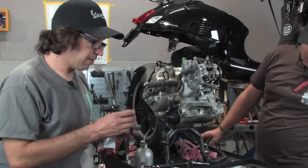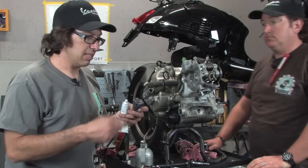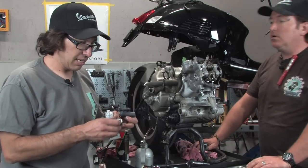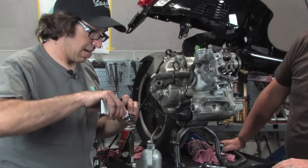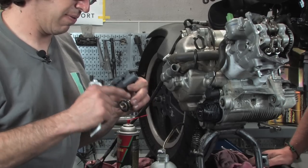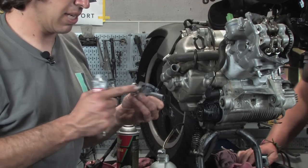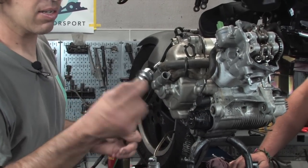All right, we're gonna go ahead and reinstall the existing thermostat and thermostat housing. This is actually still pretty flat, but still, anytime you reuse this, you need to put a small amount of silicone sealant on the edge and let that cure up a little bit before you fill the thing with coolant. Doesn't need too much time to cure up, but go ahead and goo that up just a little